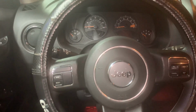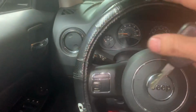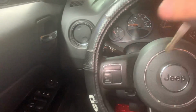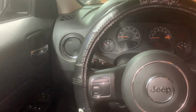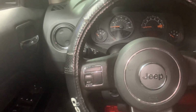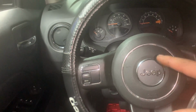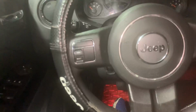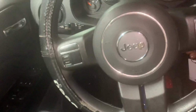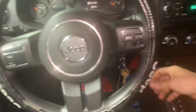It's not like, oh, you know, because the wires you just saw in the fender are what's called a body harness. It's not the engine harness. It's the body harness. It connects the fuse box to the dash harness. So it's like a body harness that goes from the fuse box behind the dash and then plugs up to everything else behind the dash. So if I would have got those wires wrong, there would be stuff in the dash that doesn't work, and you would notice stuff in the dash that doesn't work.